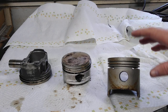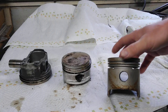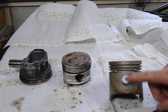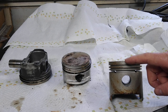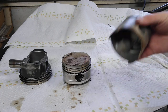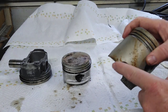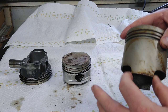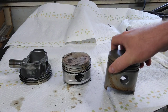Realistically, 74 to 76 millimeter strokes is pretty much the limit with this piston. You could go more, but you're going to be doing a lot more work — you'll definitely have to add shims underneath the cylinder. If you put a 74mm stroke with this piston, it's going to stick out of the top of the cylinder about two and a half millimeters. You'll also run into the problem of the counterweights hitting the bottom of the skirt.